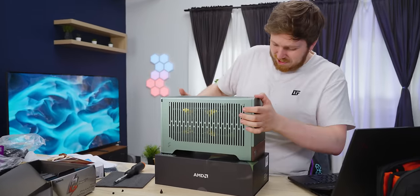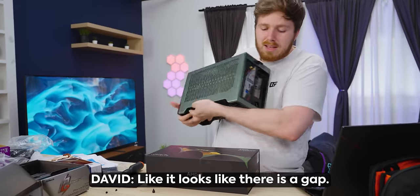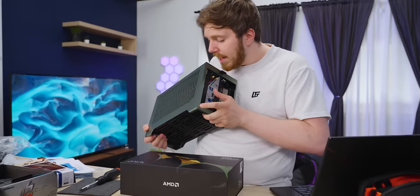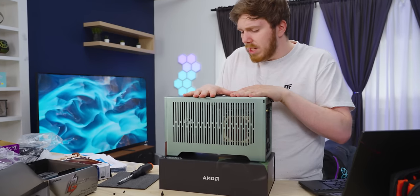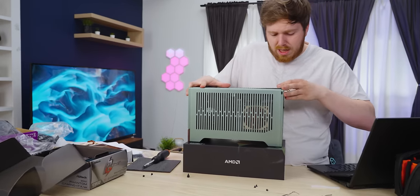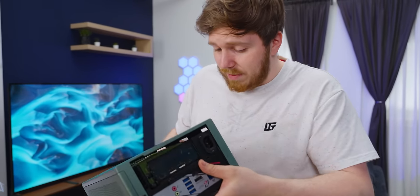You don't even really need to do the cables — I think it looks pretty slick, and the layout of the case does hide a lot of the mess. There's no seal on the back, which is kind of interesting, but I think that's a fine concession for the flexibility and it also allows for some more free airflow. One thing of note: there's not a single dust filter on this case — it's all just slits, so this might be higher maintenance than you'd want if you live in a dusty place or have pets.